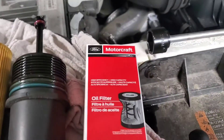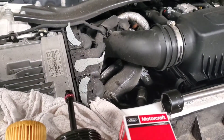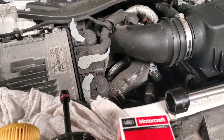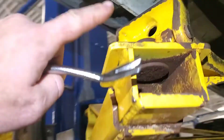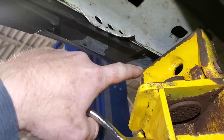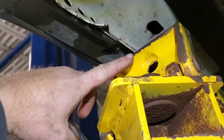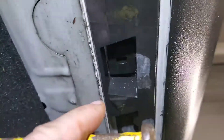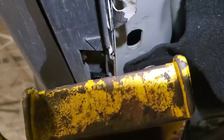With the new o-rings on the filter housing, leave the cap off for now and raise the vehicle. I want to show you the strategic lift points — you can see where somebody has been lifting this vehicle wrong, so I'm going to bend that back. It's supposed to be between the opening tabs. There are two little arrows pointing the direction, and another arrow in the back showing where to lift in the double pinch weld area.